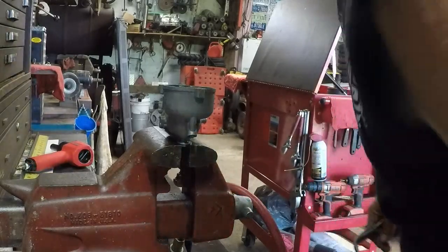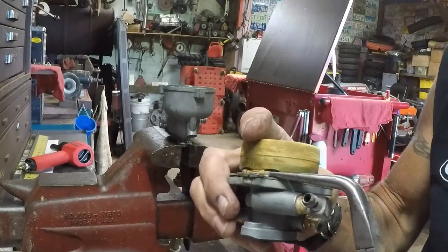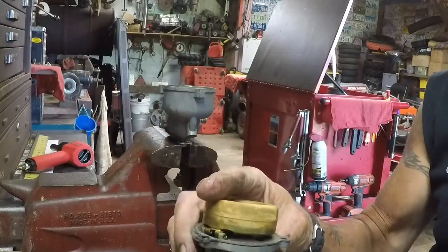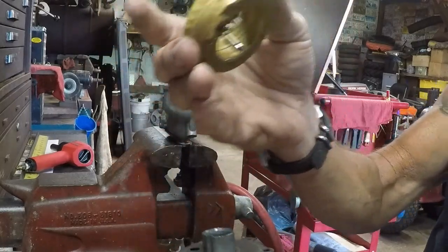I hope we don't have... Oh, I wouldn't think so, but it's something that you always want to check. See, it's easy enough. Just pull the pin, just like that, and lift it straight up out. That'll pull the needle out as well on a little spring. There's the needle dangling right there. You can see the rust color on that needle.